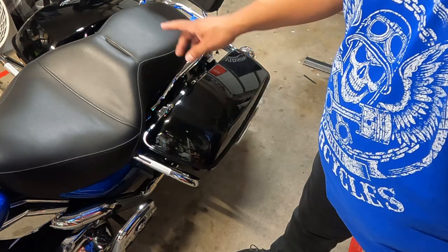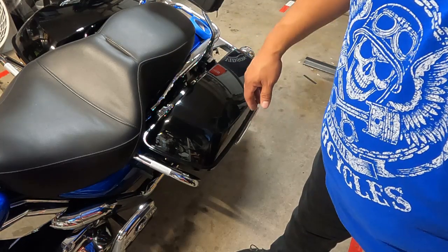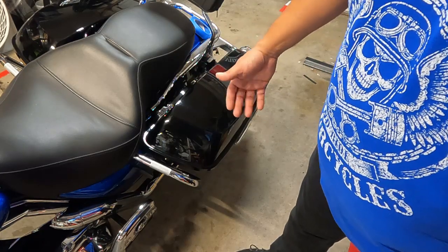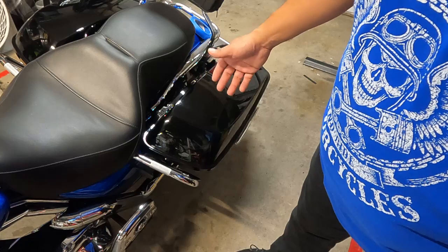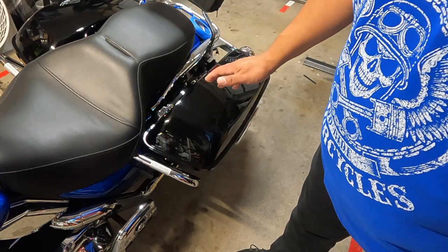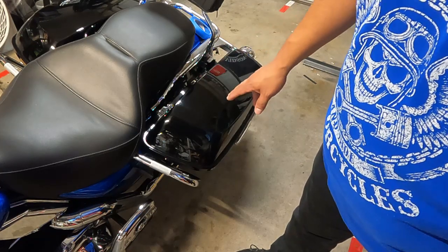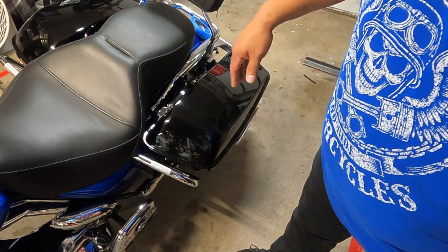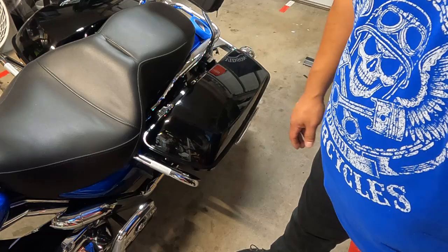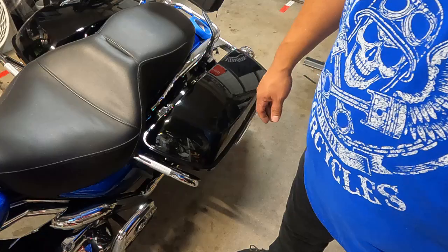The other piece of advice that I picked up on was, if you're using a jigsaw like we're going to use, they said to use an aggressive wood blade instead of a metal blade. I tend to have a smoother cut with metal, but the important part of that was speed. If you run your jigsaw too quickly, it starts to melt the plastic and it fuses itself back together, so you end up having to cut twice. So slow the speed down, make your cuts, don't rush the process, and you're going to get a great output. So let me get these things taped up and we'll start mounting that template.